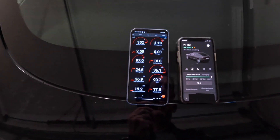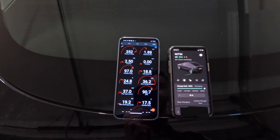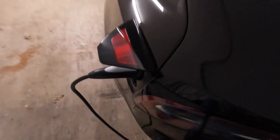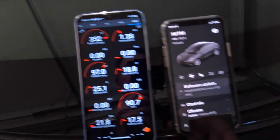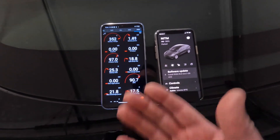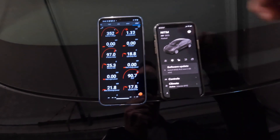The battery heating symbol is still there. What I'll do now is unplug from AC — you can hear the motor just stopped. Now we can see there is no power going to the rear motor anymore and the battery heating symbol has gone off. If you're not plugged in, it's going to take a lot longer to heat that battery up. Maybe allow even a bit more time to precondition the battery because its only option then is the heat pump, and it doesn't seem to go too crazy.